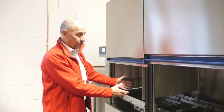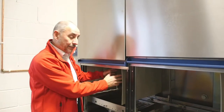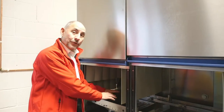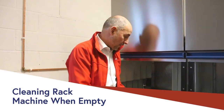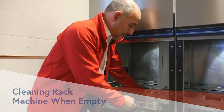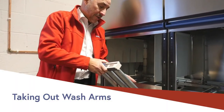After washing it down, commence taking the items out, leaving your filters in until last. That way, if there is any food debris, it will drop onto the filter and won't go into the tanks. Cleaning the Hobart rack machine after it's emptied of water: take out carefully the pre-wash arm.